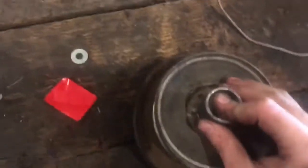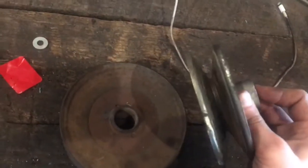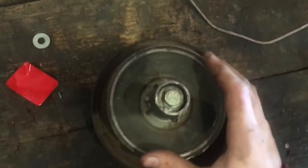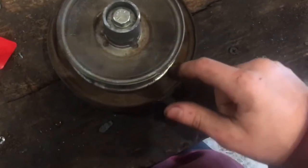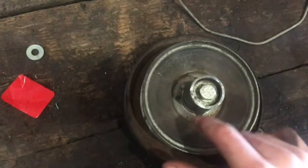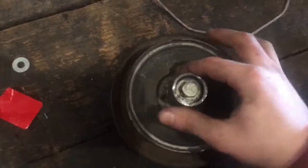And then I don't really think I'm gonna show you guys how I did the pulleys. I'm just gonna quick show you guys, but I'm not gonna make a video of it and put it in the video. So all I did is I cut the pulley. It was like this. Those were from the same pulleys. One is not rusted because it was in the frame. The other was below. I flipped it, measured everything. That's gonna be welded right center. I'm just gonna weld a bead around the edge of that, right to the rim. And then this big one's gonna be the drive pulley, and this one is just gonna be on the bottom holding it up because the key is lower down and I need the pulley up. So that's how that's gonna work.